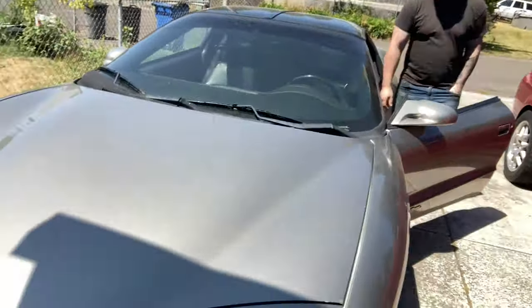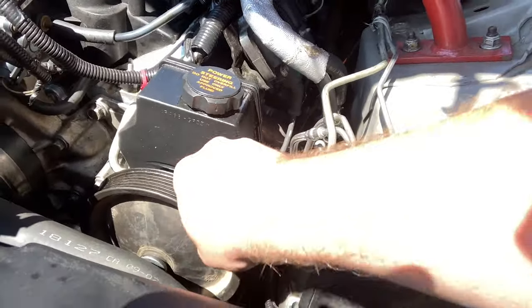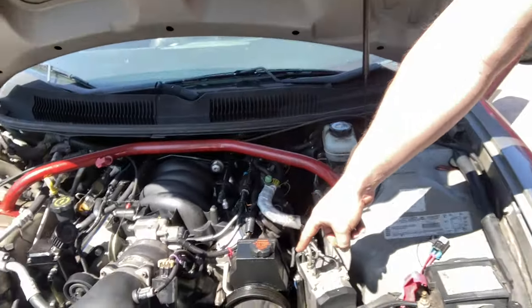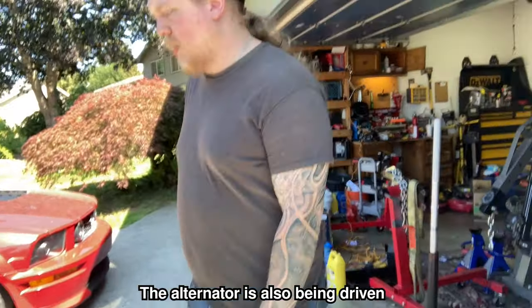We got this wideband put in — it's powered on and everything, looks real nice. Also have our USB over here for data logging, so we can tuck that up out of the way when we don't need it. We're gonna go take on a legit test drive now — it drives so much better from what Vince has told me. Also, pop the hood real fast — there was one catastrophic failure. Vince was driving and then the power steering pump just got obliterated and dug a hole into the side of the reservoir, so it leaked. So it's gonna be no power steering. Nifty trick: 52 and a half inch belt, six rib, for an LS — you can skip the idler and the power steering and run it. It's just running the water pump and the alternator.